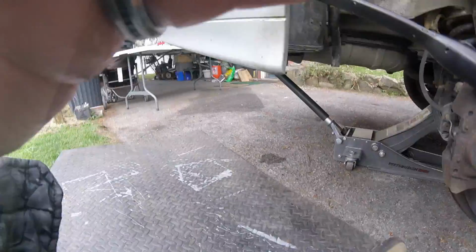I think it's got those pain in the ass type hose clips. There's kind of a trick to getting them. You got to get a little screwdriver, get in the opening on them and pop them open. Then you got to get a bent needle nose and crimp them back together. You could always go with a regular hose clamp if you find them too much of a pain in the ass to fiddle with.